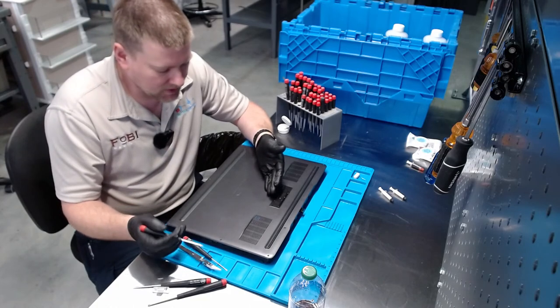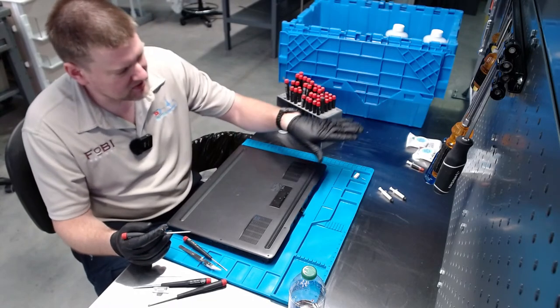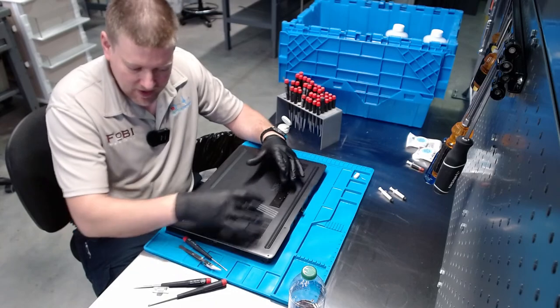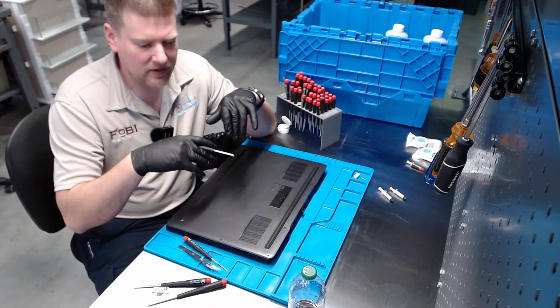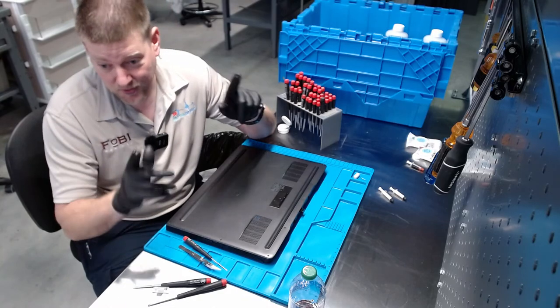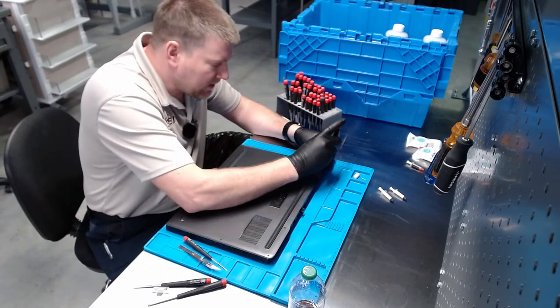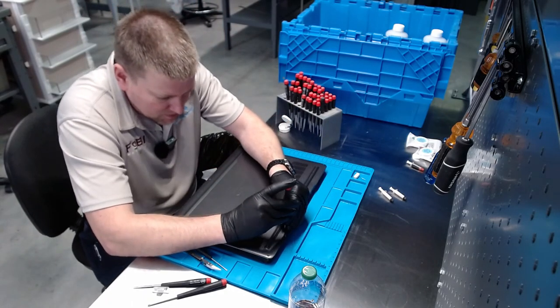It's liquid cooled currently, but I wanna get rid of all the thermal pads that are in there and replace it with the K5 Pro. And if I have other things like my NVMe drives in there, I wanna go ahead and take out the thermal pads that are in those NVMe drives and replace it with thermal paste, just like we did with this guy. You know, it's just regular maintenance, but hopefully it's also for some performance improvement.